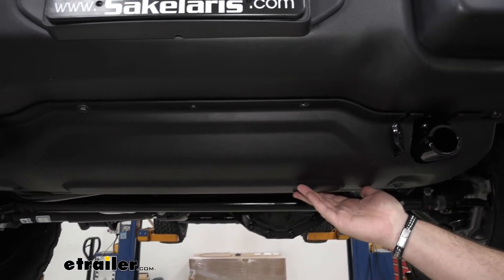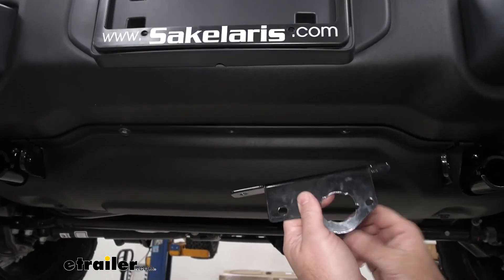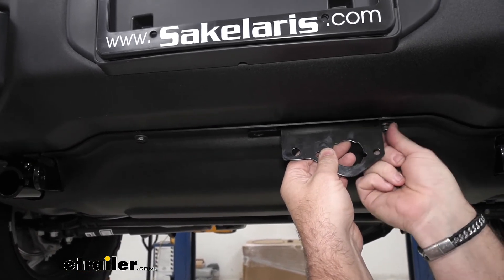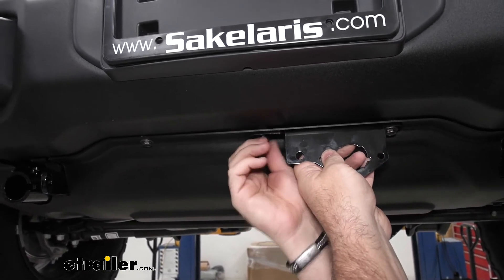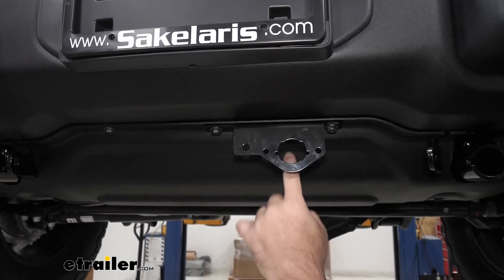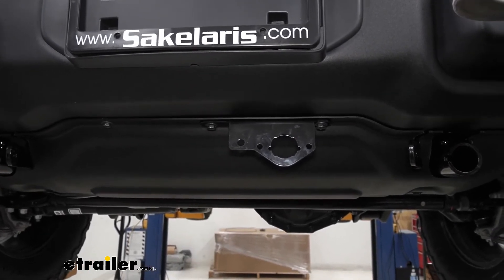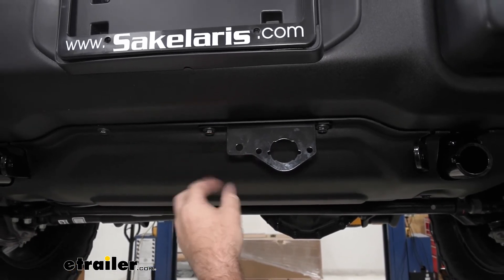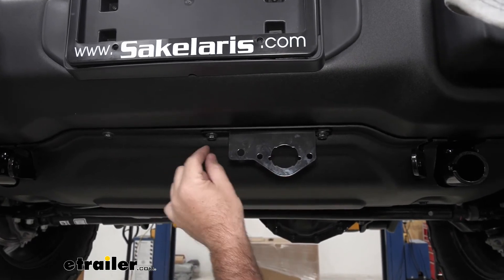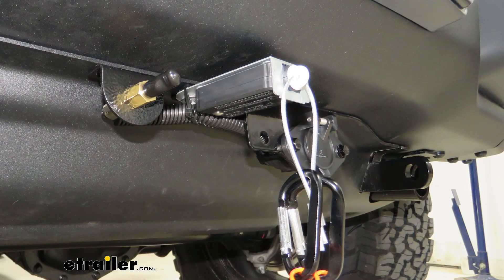Once you get it cut out, go ahead and put your pan back up in place — you're going to leave these two bolts out. Your kit is going to come with a bracket for your wiring that lines up exactly with the holes already in the rock guard, so you won't have to drill any holes to get that bracket installed. Keep in mind, when you install your wiring you are going to have to drill a small hole back here to run your wires back behind this pan to the back of the vehicle. Depending on which braking system you're putting in, you'll also have a breakaway switch to run. If you're doing the Air Force One, which we'll be installing later, we're going to have an airline tube. Rather than drilling three separate holes, I'm going to drill one hole here, mount my breakaway switch on this bolt, mount my air fitting here, and run everything over to that one hole so it all stays nice and clean looking.